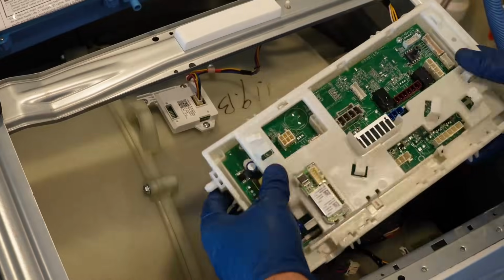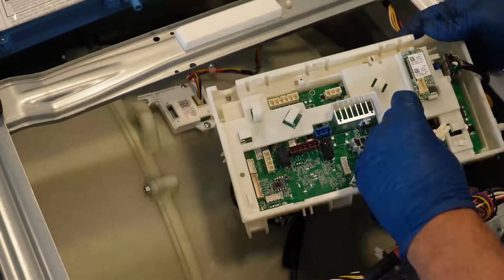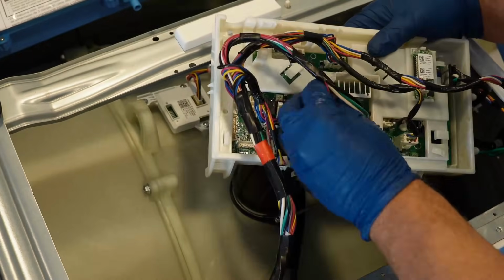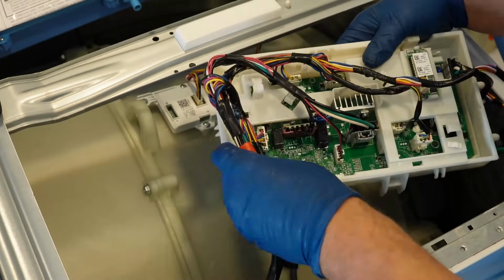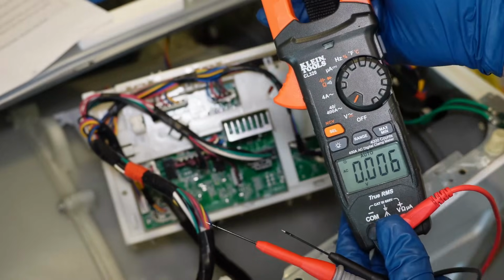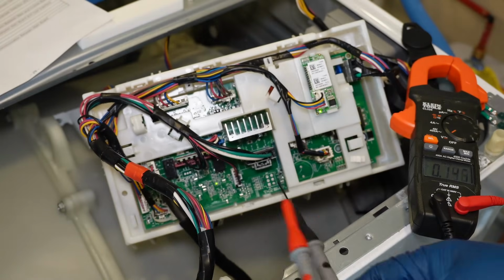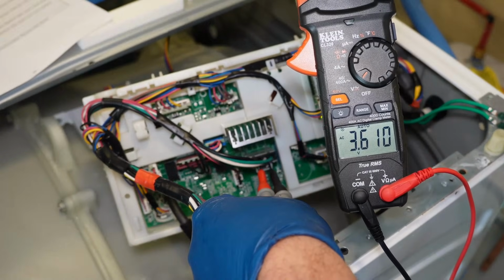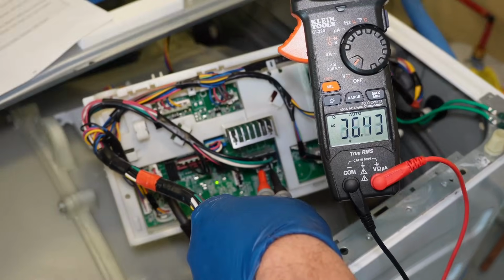One extremely advanced test you could do if you're really frustrated with this machine is to plug the unit in and simply pull wire harnesses off the board and see if the removal of any particular wire stops the board from resetting. I don't recommend doing this unless you're a tech, but if you're still having issues at this point, well, it's the only way you may be able to figure out which load is causing the issue with wiring or a part is causing the system to fail.